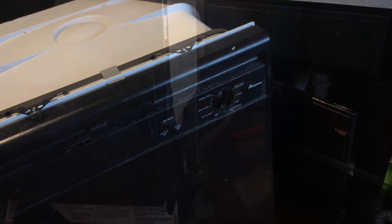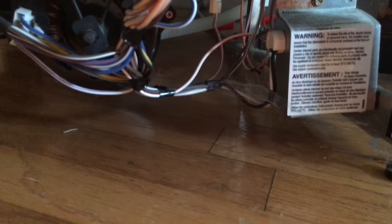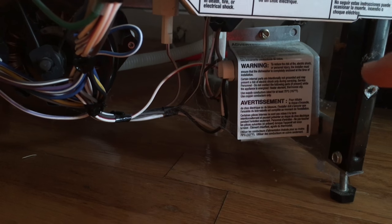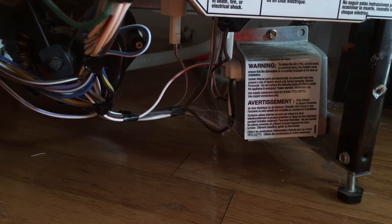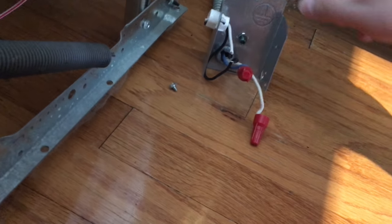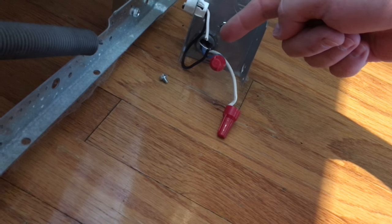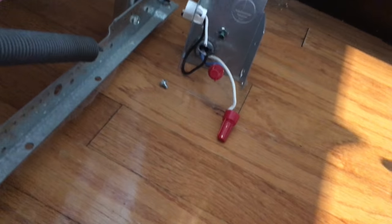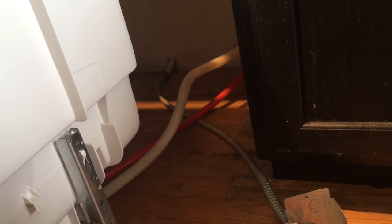That electrical line leads to this electrical box over here — as you can see there's a warning label. We have to take that bolt off and carefully disconnect a few things. I'm going to double-check that I have the power off before I do this. Good news with this model: all I had to do was untie the wire connections while the power was off, then cap each one. You can use electrical tape as well. I unbolted this and removed it — it's a hard wire.